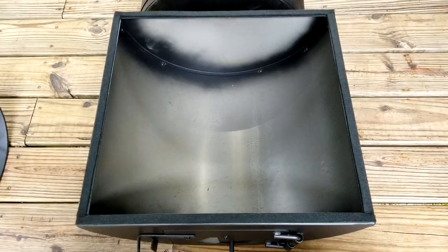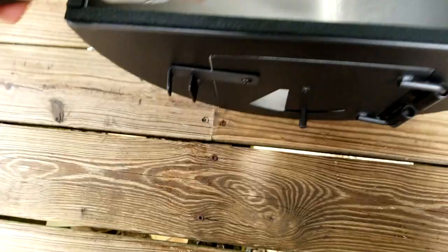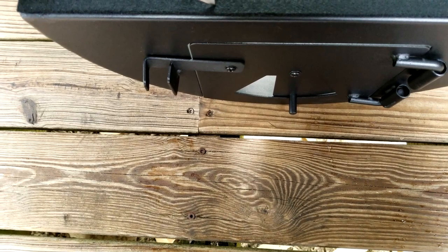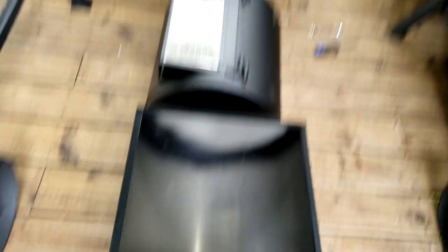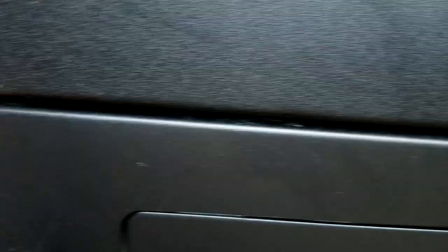There are four holes — two on each side. Take a sharp razor blade, find the hole, push it in and go across, then flip your blade and cut the other way. That's exactly what I did, and the bolts line up fine — you won't have to worry about anything. After cutting those four holes, get the top of the lid bolted on. Then take the rubbing alcohol, clean out the outer edge, and put the same seal around that part.